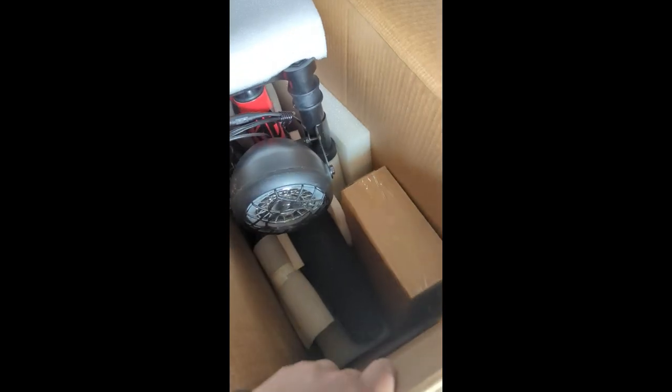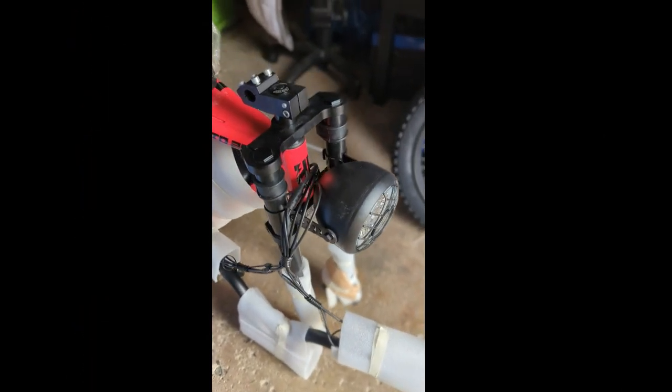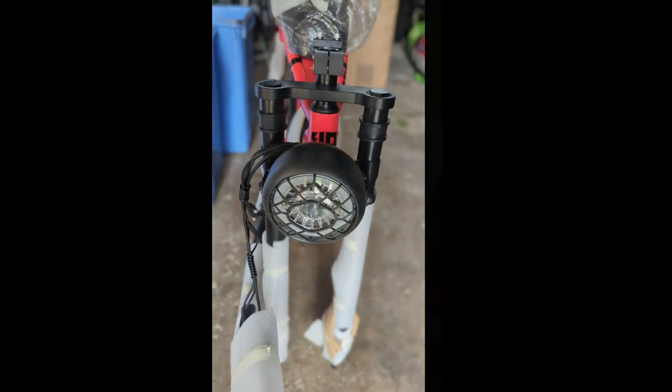Lifting up the top layer, you can see all the parts are inside. There are a couple of things to watch for. First, my neck stem was on backwards when I got it from the factory. The bike is about 80% assembled when you pull it out. Everything is well wrapped, taped up, and zip tied. The front wheel is a separate unit — you need to assemble that and put the rotor on before mounting it to the bike. The parts box has everything needed to complete the bike and is tucked away near the bottom of the main box.